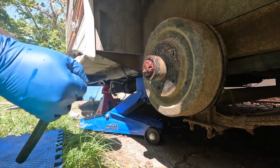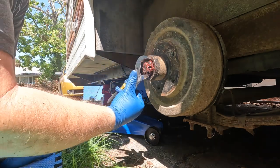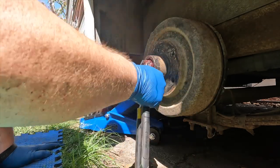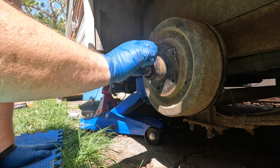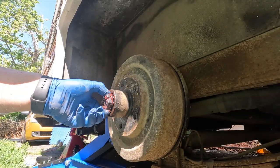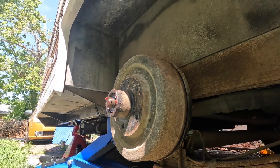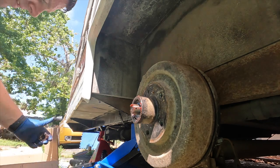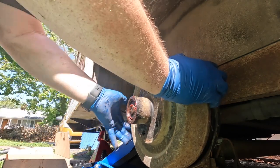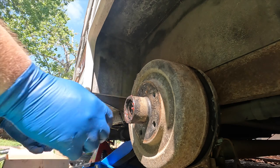One of the biggest issues I've discovered is keeping everything clean — not easy. A shop would be great for this because just the dirt and grass on the ground has made everything difficult. You want to keep the inside area clean. This is the castle nut — pretty easy to remember because it kind of looks like a castle, it's one of the few parts I actually know the name of. It's supposed to be hand-tightened, so I used pliers to get a good grip and get started, but it wasn't that hard from there. Now this hub can work its way off the spindle — there's a washer, so it goes castle nut, washer...